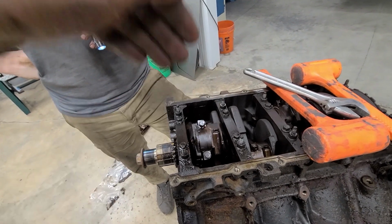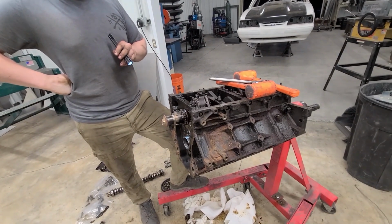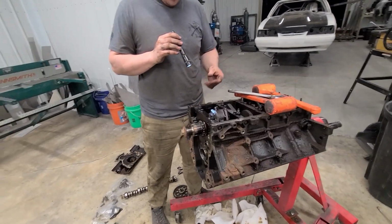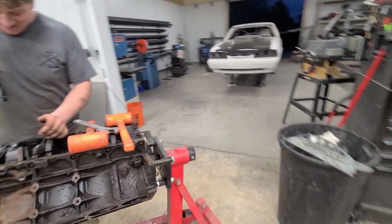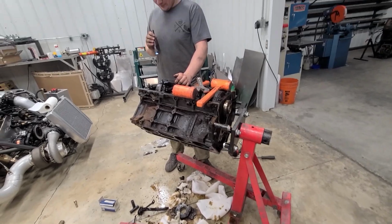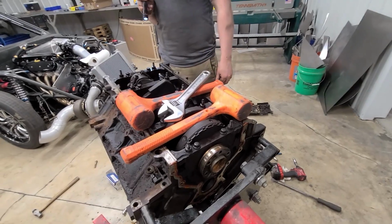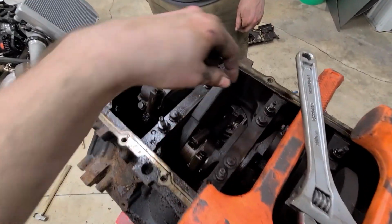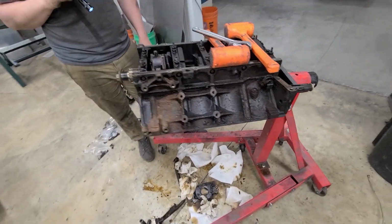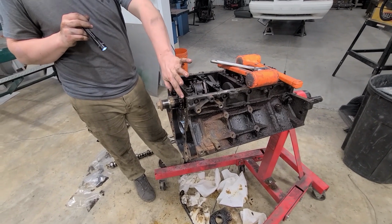And then we could drop it down in there. But it's like a tomorrow problem, because I really don't want to take a rod out tonight. We almost had it. We were very close because we got all the other cam bearings in, dropping the bearings down between the rods, putting it on the end and then tapping it. It's close. No cigar.